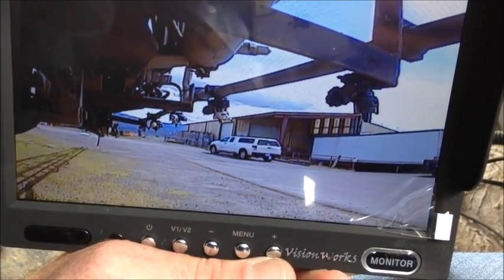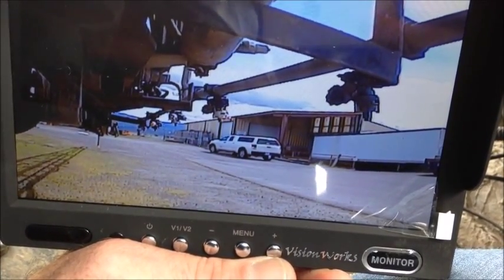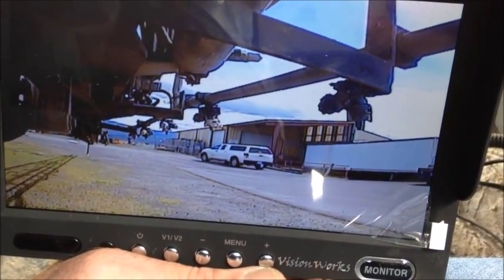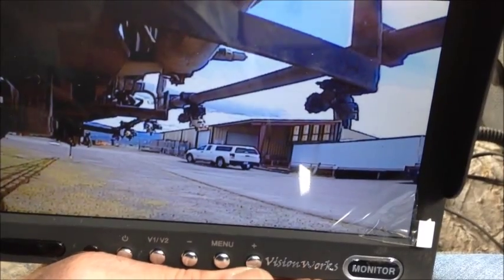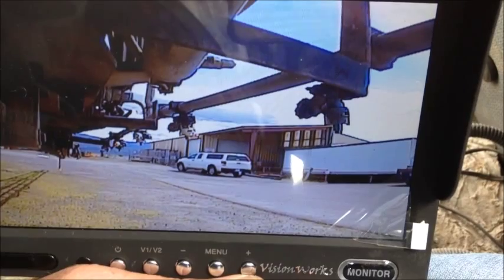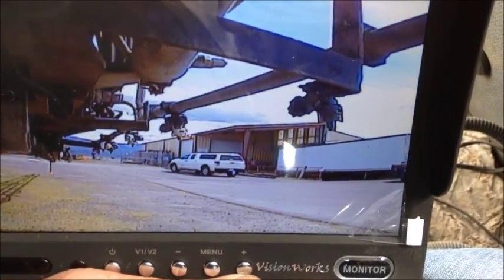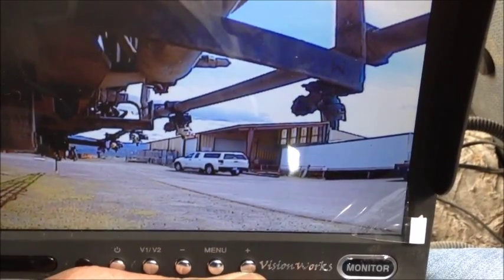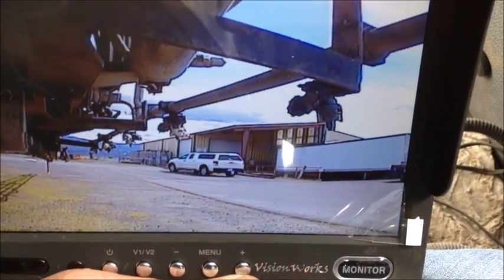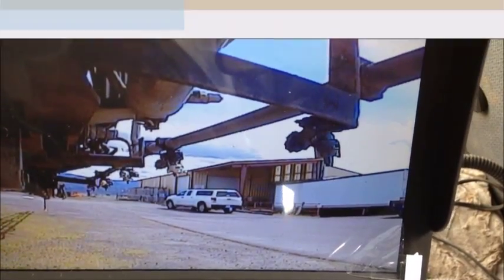You can see we're watching about four or five tips in the back section of that sprayer boom. When in operation you'll be able to see if you have a plugged nozzle, saving a lot of heartache in the future if you are an applicator. This TCON image reversal is also very handy if the camera is pointing in the same direction you're traveling — for example in a hay baler — where you want right to be right and left to be left.